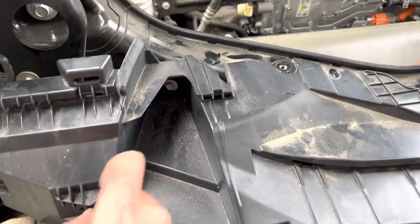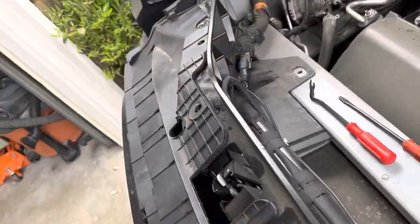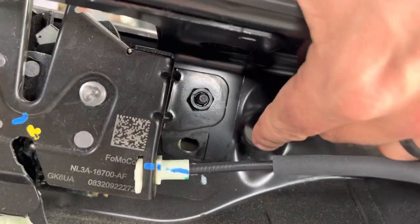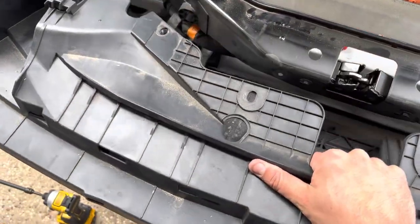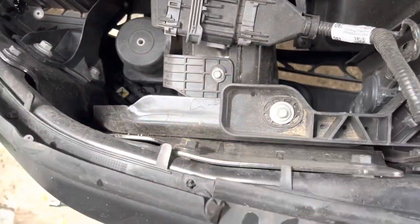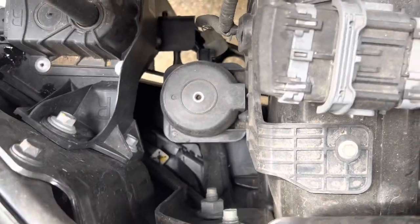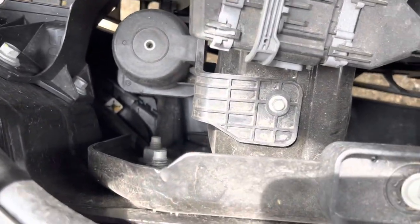Next step, we're going to try and take this plastic piece off — I only see two bolts here and here. After looking a little harder, these white clips are basically holding it on. I've got some needle-nose pliers and I'm going to try squeezing this — and that looks like it did it. This will slide right out now. The truck's getting pretty naked at this point. Now we can look down — we have one, two, three on each side — those are the six main bolts to hold the bumper on. Those are 21mm. We also need to push down on this piece, pop it out, and work this plug out. I believe the bumper's unhooked from everything now, so we just need to undo those bolts and lower it to start installing.